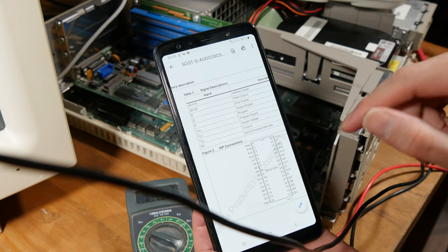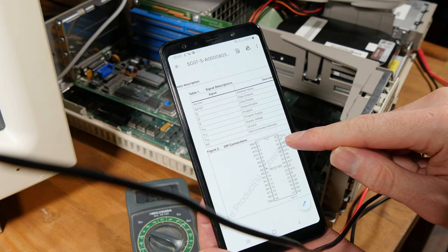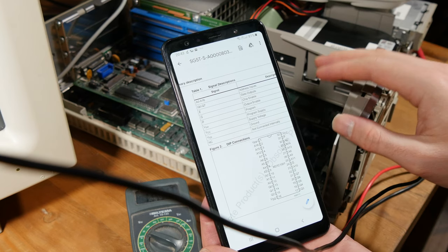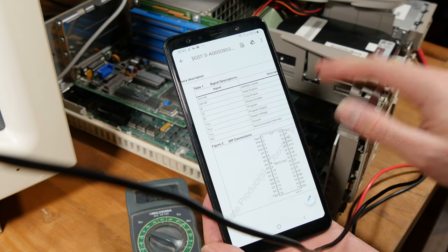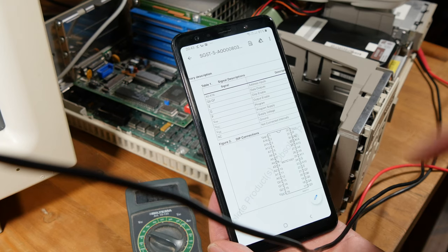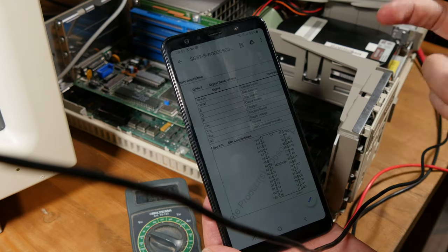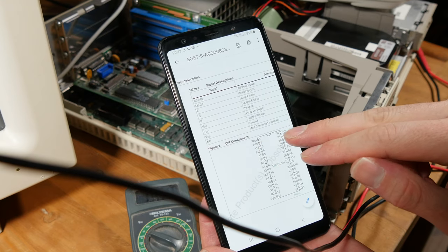And I don't know if the supply voltage is supposed to come from the battery. Is the information that I am trying to make in the BIOS saved on the chip? I'm not sure, but I'm going to try to measure the voltage now on pin 32. It's supposed to be 6 volts, so I'm guessing that it should be from the battery.